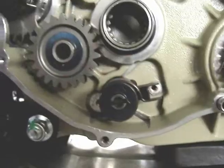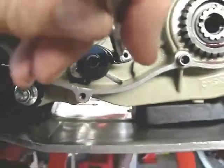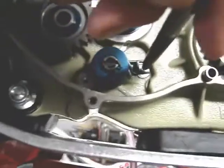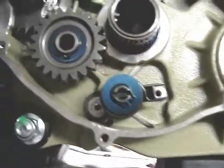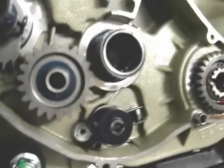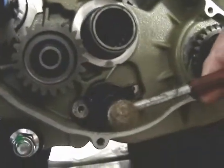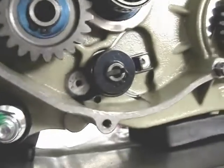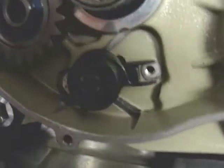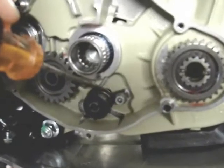The drum has some depressions around its interior and they must line up with these two depressions carved into the case that I'm pointing to there with my pointer. This way when you reinstall it, those pieces are aligned properly. When you put the shaft back into the engine, you will have to hold the two spring-loaded little wheels together with your fingers as you guide it in there. I point here to the eccentric mounting hole and the two little fingers on the spring — that's the proper alignment position for reinstalling the shaft. It may be required to lightly tap on it — don't beat on it, just coax it in a little bit. Then you may need to take a small screwdriver or something and tap the bearing on into its seated position in the case.